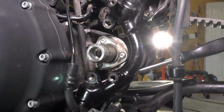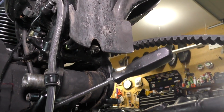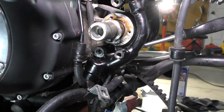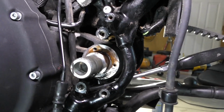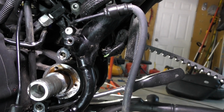So now I'm going to take this plate off and try to slip this inner shaft out, so that I can try to get the other rubber mount out on the right side of the bike. All right. I took the plate off here, and I put some WD-40, squirted it on both sides of that inner shaft. They say it could come out hard. I also want to clean it up because it's very rusted, I can see. It mounts very tight in the motor, and I just hit it a little bit from the other side and it's sliding right out.